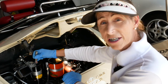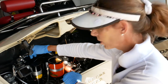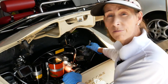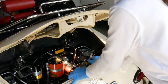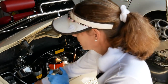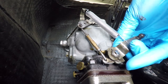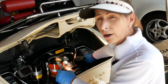First off, we'll check our flows on each side. The little red ball is right in the middle where it should be — we're good and balanced, but our idle is pretty high. Looking at the tachometer, we're at almost 1400 RPM, so we're way high. Let's run this down using our flow meter to make sure we get it down the same for both carburetors. All I'm doing is running the idle stop down — we're done messing with the air bleeds on the sides.